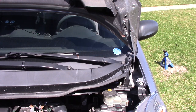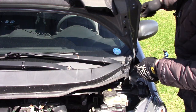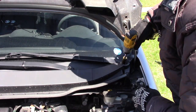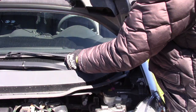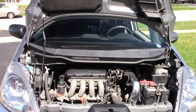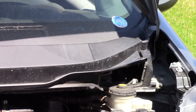First we've got to get the windshield wipers off, and those are taken care of with these two little plastic caps here. Using a proper trim tool these little caps pop up really nice and easy. They unfasten very easily with the use of a 14 millimeter socket. You can pry them up by hand and they come right off. Next, remove this rubber trim piece — it just pulls right off — then pry this trim piece upward to remove.